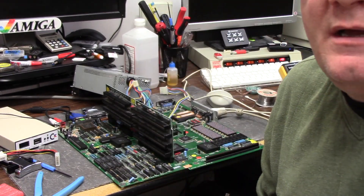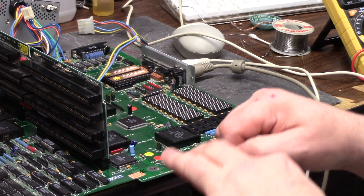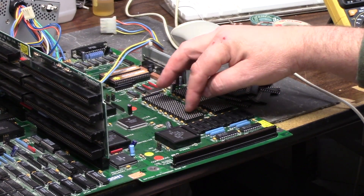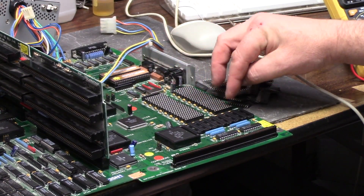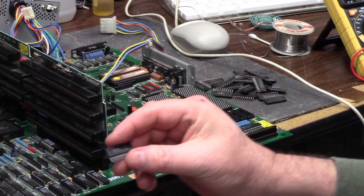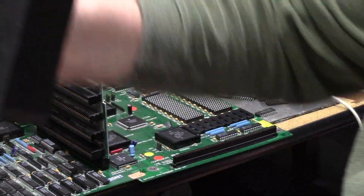You either love them or you hate them, and they go in these slots right here. They're a big pain in the butt, and the problem I had with this RAM last time is they were all in backwards. They go in banks of four — meaning there are four banks: slot zero, slot one, slot two, slot three — that's one bank. But they have to be in zero-zero-zero-zero, then zero-zero-zero-zero, then one-one-one-one, two-three, and so on. That's how you load up all 16 megs of RAM.